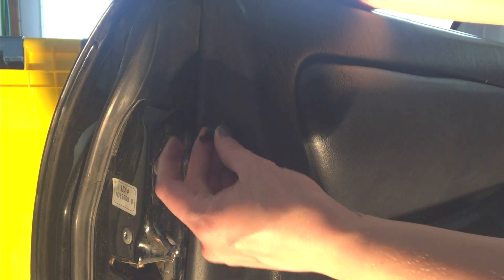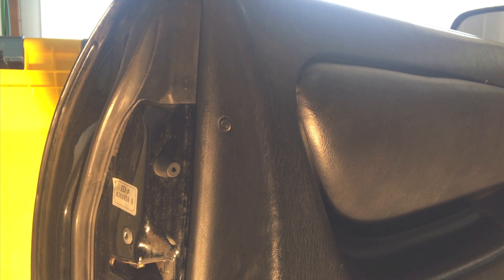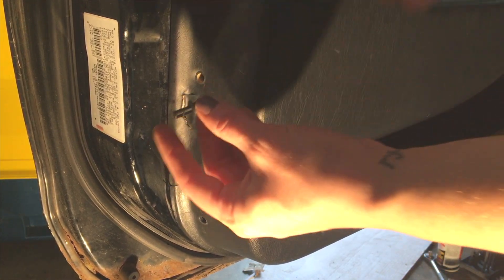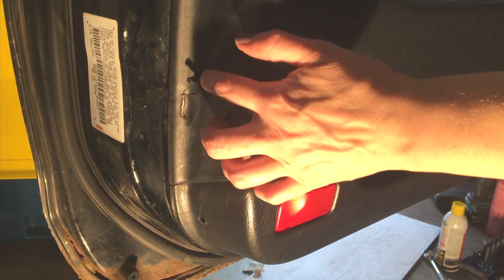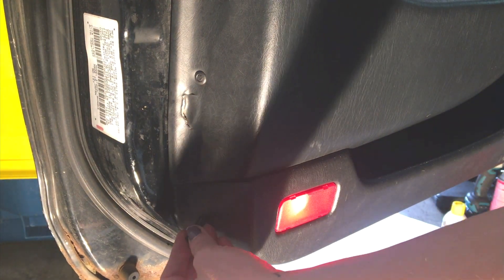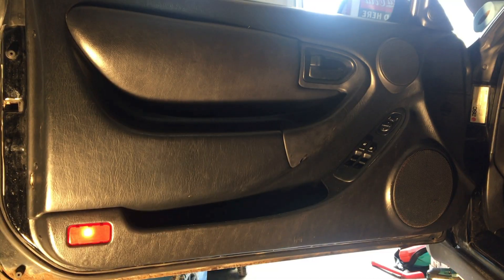You have to have it slid out, so you pop it back in like that and then just push it - it's good to go. You want to push it out like that, then pop it back. The door is all back together and my side mirrors work, so I am very happy and very excited about that. So that's how you remove and reinstall a door card. I hope you found this helpful - let me know if you have any questions, I'll be happy to answer them. Thank you for watching!